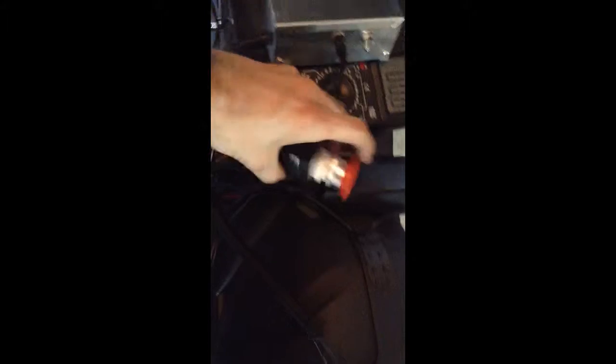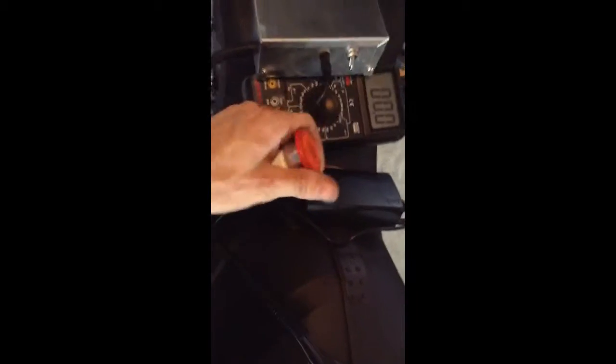Say we need an emergency and we need to stop — we hit the switch. The bike's off. Turn the switch back on. Bike is still off. Take the RFID tag, re-present it, bike turns on. If you present it multiple times, it doesn't do anything, because it's always going to keep those relays pressed.